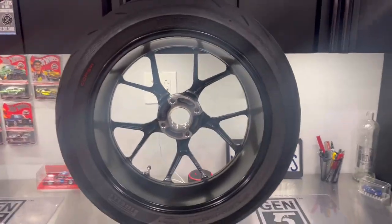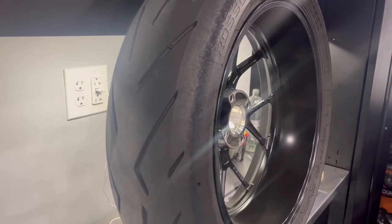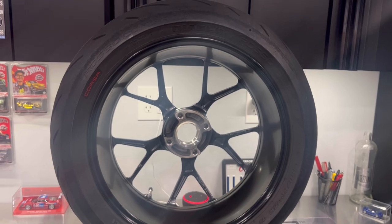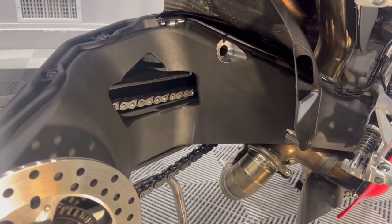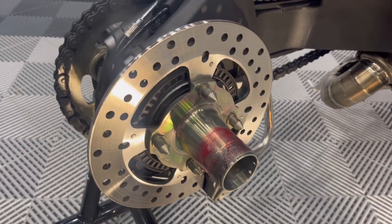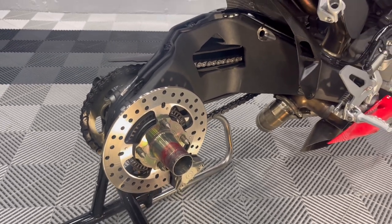Despite being wider, we got the stock rear wheel on the scale and we're at 24 pounds, 11 ounces or so. Tire wear is pretty close to equivalent. Since the wheel's off, I went ahead and took the opportunity to clean the inside of the swing arm — it wasn't super dirty but cleaned it anyway — same goes with the brake caliper. Wiped off the old grease and put a little bit of Lucas Red and Tacky on there. It's a high-temp wheel bearing grease — a general purpose grease. You don't need a lot, just a little coating is really all you need.